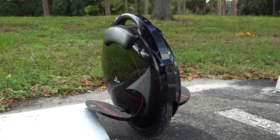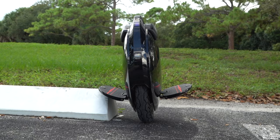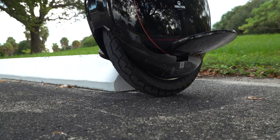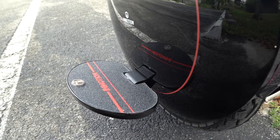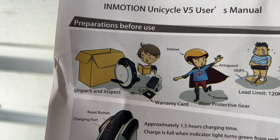It's been nearly half a decade since the first and also last time I was on an electric unicycle, so that meant relearning how to ride this thing. Fortunately, the InMotion V5 is pretty beginner friendly. It's got a small 14-inch wheel that is still large enough to feel more stable than little scooter wheels, a low-power 450-watt motor that won't make you feel like it's going to shoot out from under you, and a small 188 watt-hour battery that doesn't do range any favors at just 12.5 miles, but does keep the thing pretty lightweight at 25 pounds, making it easier to handle underneath you.